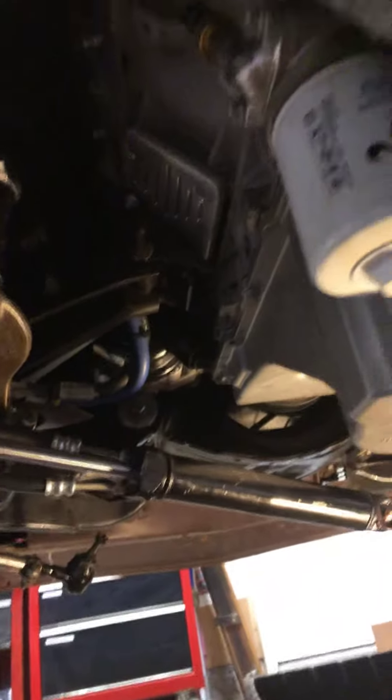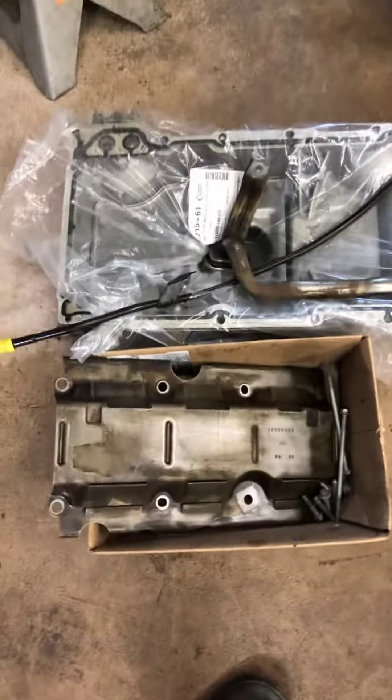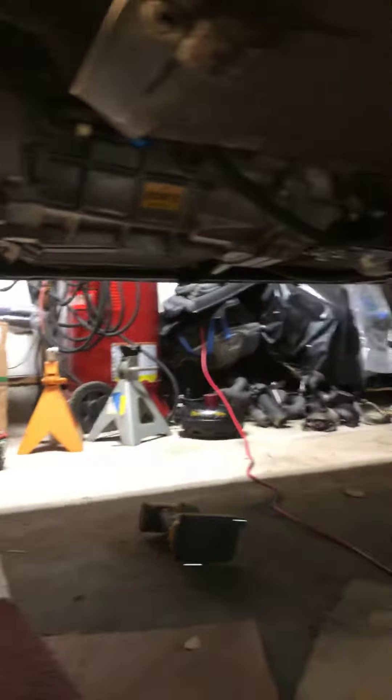I really didn't want to drop the engine. Next, once I get this buttoned up, I've got the right stuff over here from the surplus LS1 — a new Camaro pan, the pickup, and a windage tray. I'm gonna clean that up, put this back together, and then up comes the T56 for the new clutch.